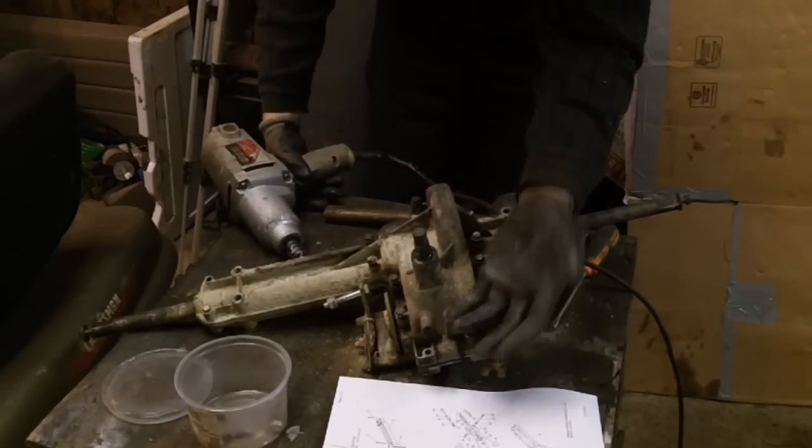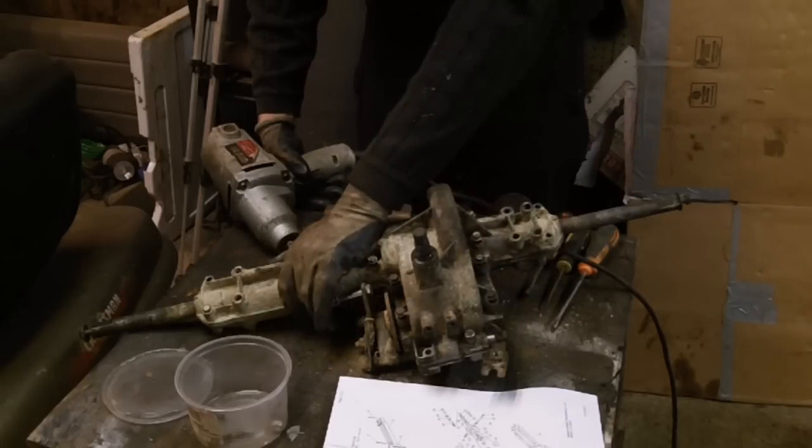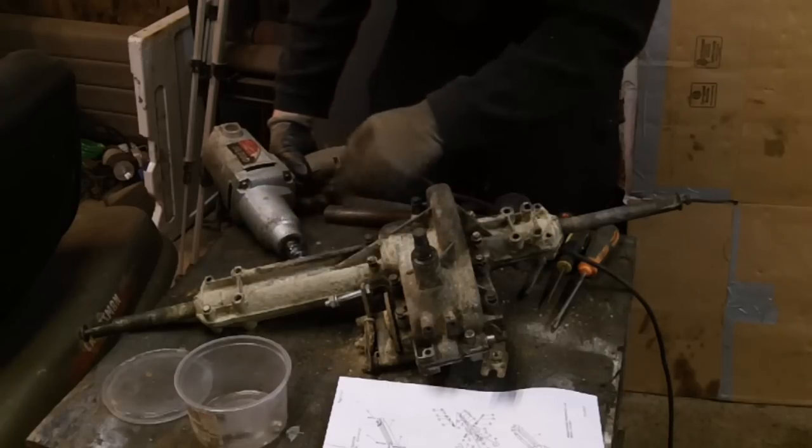The other thing that I'll note that I've learned with the Peerless transmissions is setting your thumb on the seam of the transmission. That way when the seam does start to pop, you'll actually feel it, which is what it just did on this end.